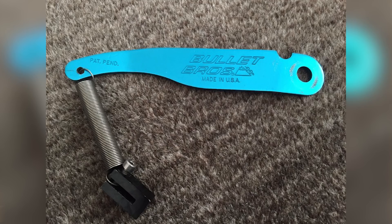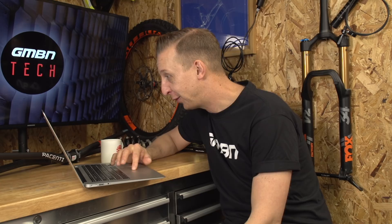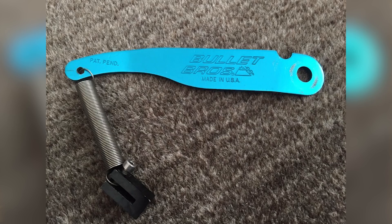Now it's time for Rewind — the retro corner of the show where we check out where stuff has come from and the development of parts, plus all your retro goodies. First up this week from Aaron of Portsmouth — I recognize your name from the orange E2 you entered into Bike Vault that got super nice for the XT Sharkfin on it. He's sent in an old Bullet Brothers chain tensioner. In the pre-clutch mech days this would go underneath your quick release on the back of the bike, and that spring would hold the cage of the mech up to give you supreme chain tension, silence the bike, and help stop the chain coming off. It worked really well but would eventually wear out the springs in your rear mech due to friction, and made it really hard to change gear because you're fighting that powerful spring.